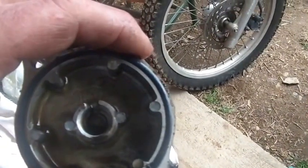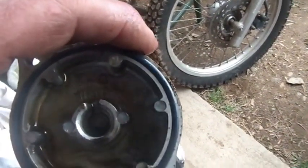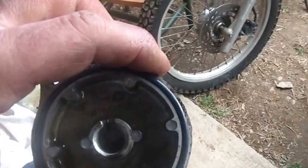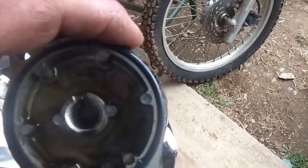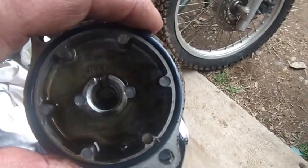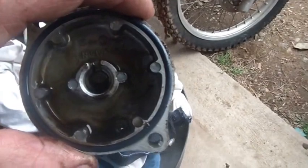right? You want to be very gentle, just use your wrist or maybe your fingers, depending on how strong your wrist is, right? You don't want to break those 8 millimeter drive bolts off. You want to make sure you don't lose that aluminum gasket down on the bolt there, right? You lose that, you'll drip oil forever and ever, and you don't want to do that either.